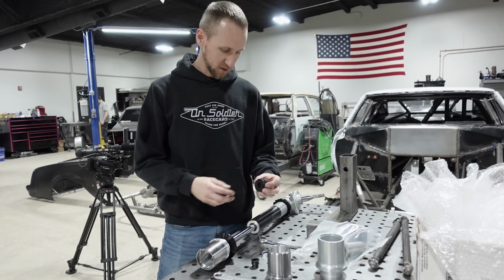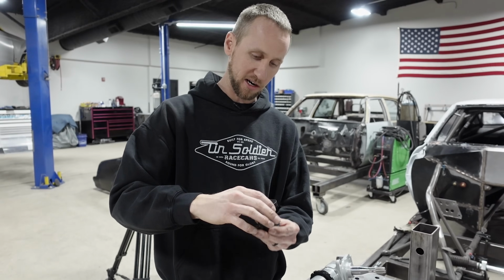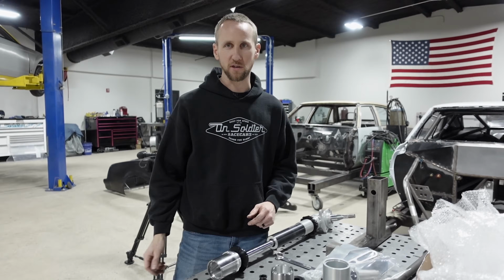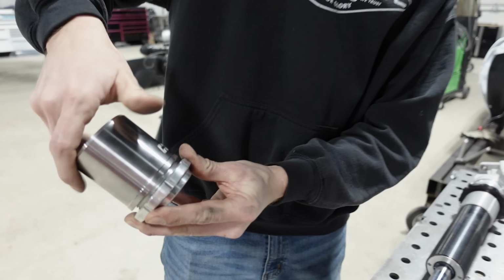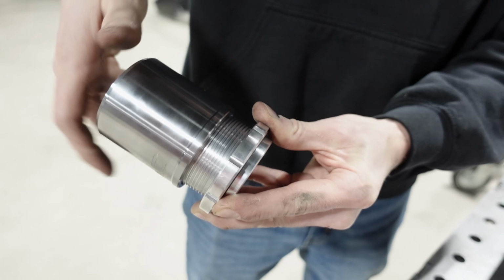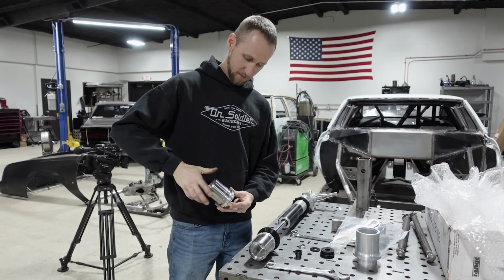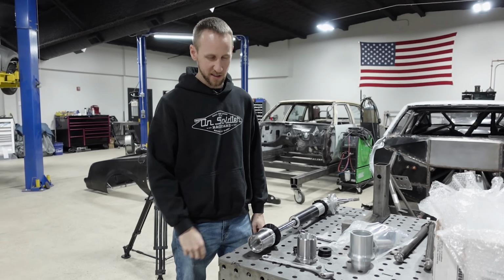Got you. Cool. So this is the old school way, like it was mounted before. It would have just had a tab here with 2 rubber bushings, and that kind of binds up, so it doesn't allow it to travel as freely. Gotcha. The other nice thing about the strut cups is that you can do ride height adjustment without adjusting the spring. Oh, sick. So that's smart. These make it really, really easy to mount a set of struts on the front.